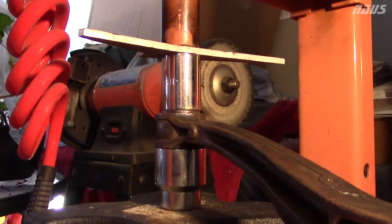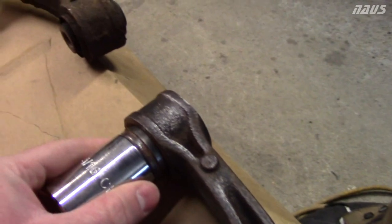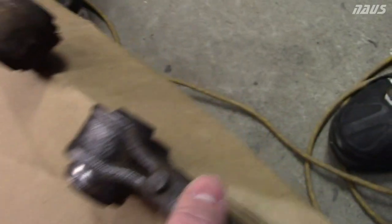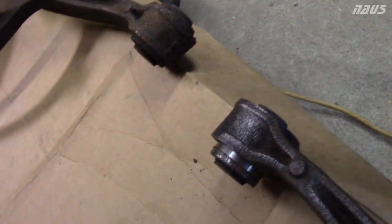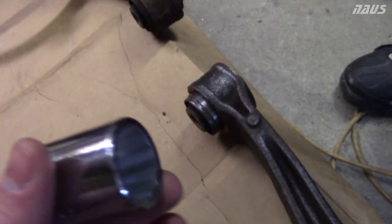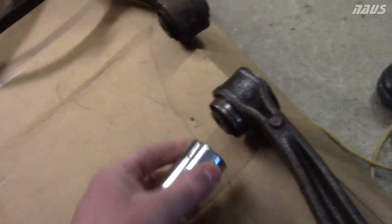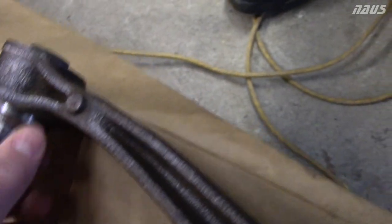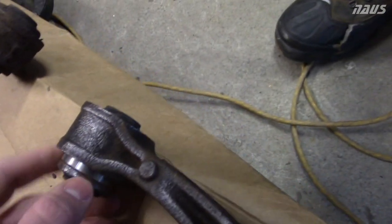That's actually going pretty easy. So the original bushing we used to push on - we measured them with a caliper, it's like 2 or 3 thousandths bigger than the OD of the sleeve. We're going to drop down one size now that we've got it pushed pretty much flush. You don't want to ram it in there and get it bound and ruin the control arm, so we drop down to a 1 inch socket on 3/4 inch drive. It's slightly below the diameter, but once it's captive in there it won't push the material outward as much.